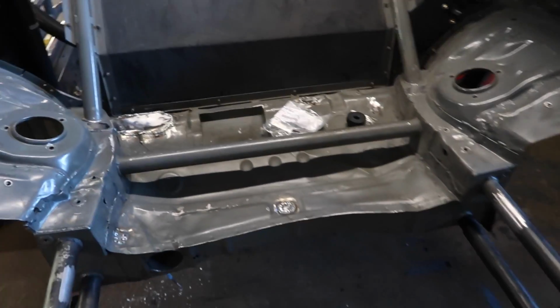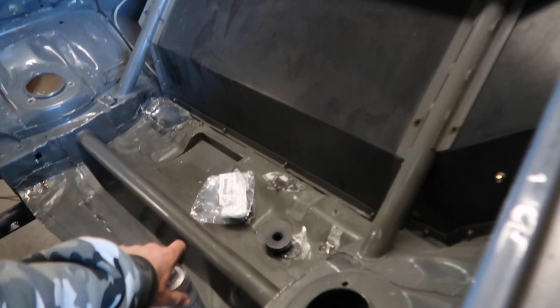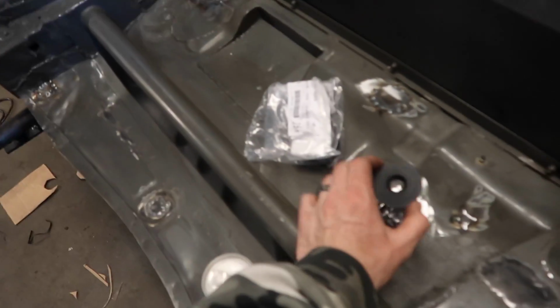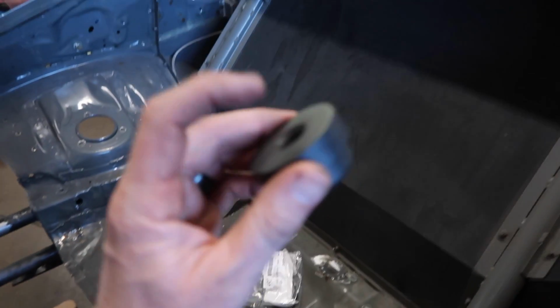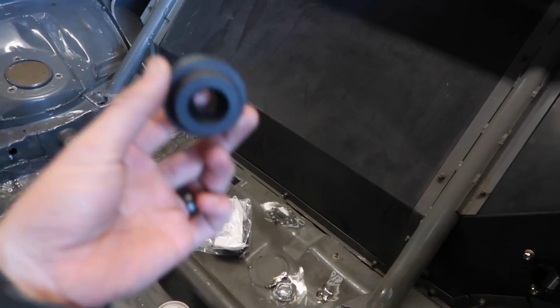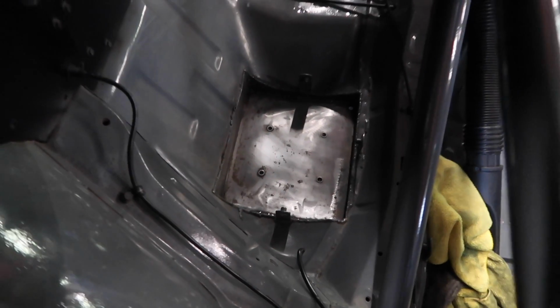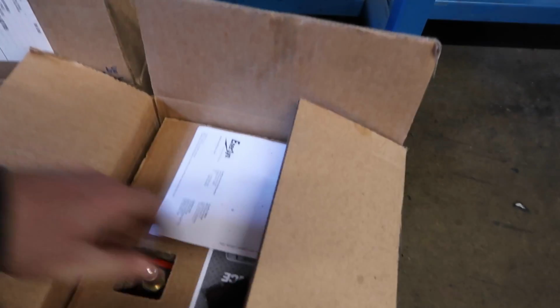Patch some stuff here. We're gonna get ready to mount the radiator here pretty soon. Got some new stock Toyota rubber bushings that go under the radiator. We'll weld a little pin on the bottom of the radiator in tank. Then these will be countersunk into the floor. Works out pretty good. We're gonna be putting a brand new PC 1200 hold down kit. Fresh one for this season. Vicha did the WiseFab in the front, so we have fresh WiseFab for this season to start the year off.